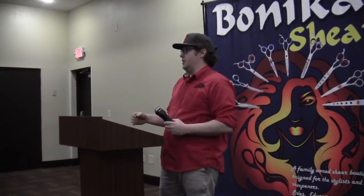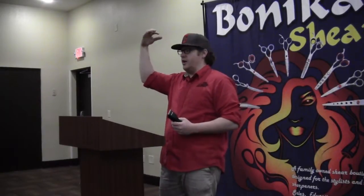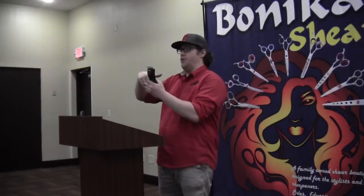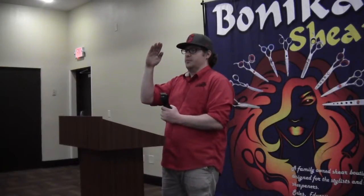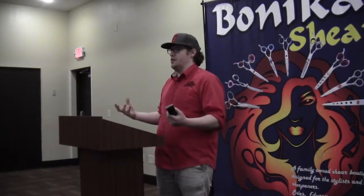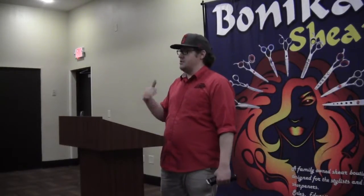Over time, especially in a lot of barbershops that have looser hair that can fall down in there, sometimes like with groomers, the fur doesn't quite get all the way down in there. But a lot of times that hair will fall in there, keeping that switch on all the time. Eventually their battery will die, they put it on the charger, and it doesn't charge because the switch is on. It's kind of a pain because it's three pieces of housing to get it all taken apart and cleaned out. But I've seen that several times with this new clipper. All in all, it's been a great clipper, but that's a different issue than we run into with most clippers, so something to keep an eye out for.